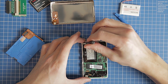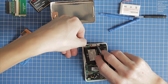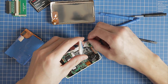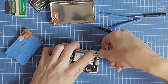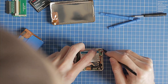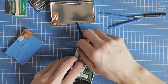Now you can change the battery. First, remove the screw next to the battery connector and disconnect the battery from the logic board. Now you can connect the new battery. Be careful when placing the battery cable. The iFixit battery has two long cables, so be patient to place it properly.